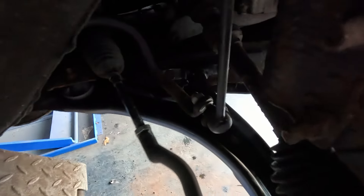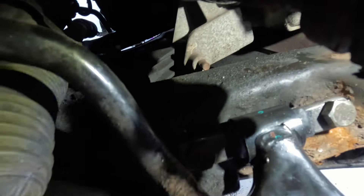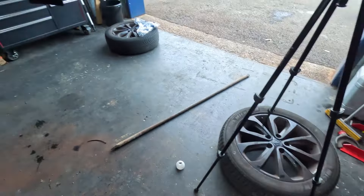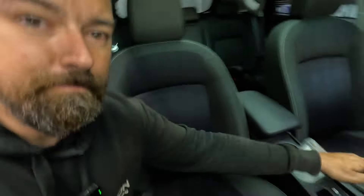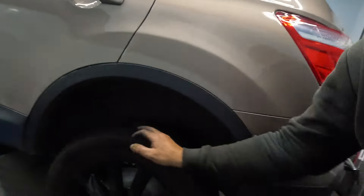There's the wishbone back on — didn't record it, just chucked it all back on. This YouTubing isn't as easy as people think. Those bolts are in, back tight — that one and that one. So that's done. I'm going to get the wheels back on now and get it outside. Now that the rear wheels are all back on I'm going to check the handbrake and see if both sides lock up. Drive side — lovely. And the nearside which was listed as inoperative — yes, we've got a handbrake. Hopefully that's sorted.